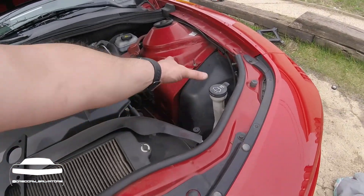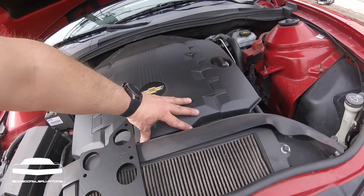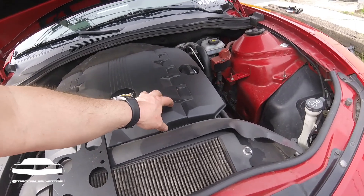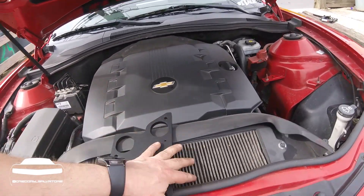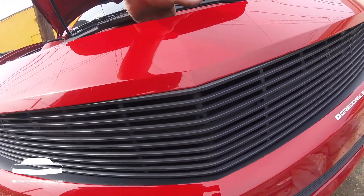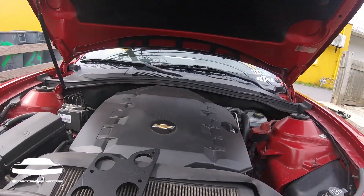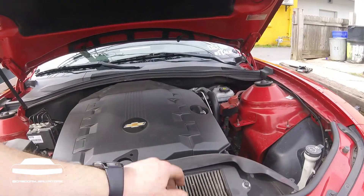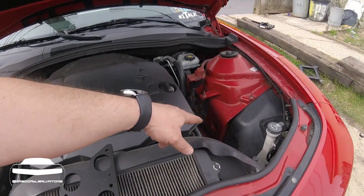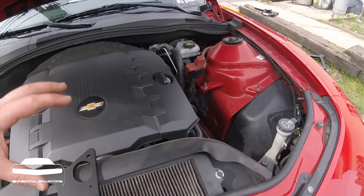I was a little skeptical. Now the difference is if you have an air box over here and you're running that long pipe to go into the intake, that's a lot of time inside the engine bay. The engine bay is about 200 degrees and you're warming up that air. With mine, I'm pulling air directly in from the grill. There's actually a deflector behind the grill in front of the radiator which shoots air up across the top, hits the top of the hood, and this gasket helps drive all the air into the air filter and right into the intake manifold. That's a big benefit and is a lot cooler than a cold air intake that's over there — even if you're pulling it from the side, it's just too much time underneath there.